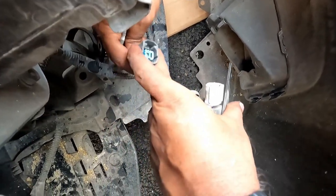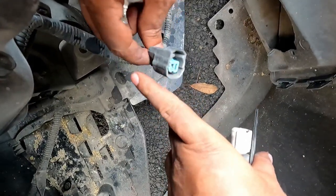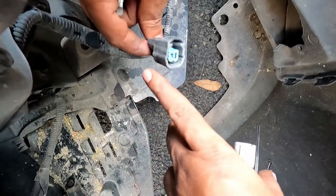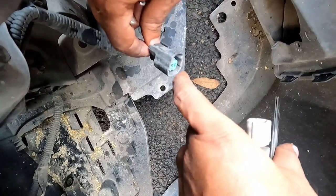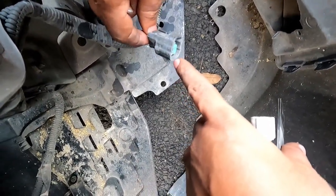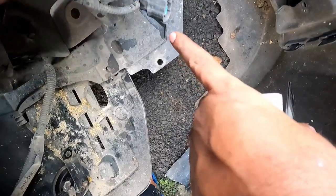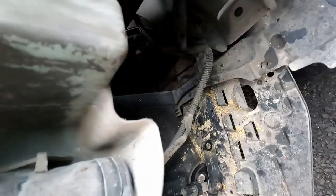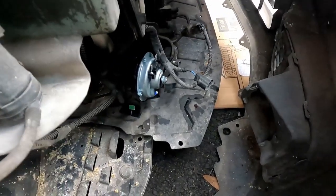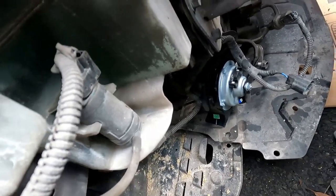Okay. So this is a proprietary connection and for this it takes only one wire, but aftermarket horns will require two wires. So the secondary wire I will take from the body, as the body is already the ground connection. I have abandoned the fixing of a different location. I am resorting to the original location again.